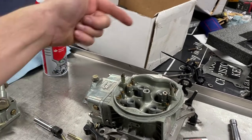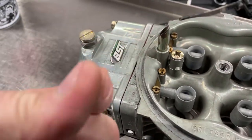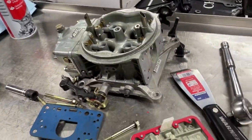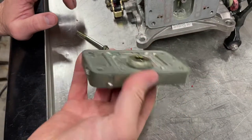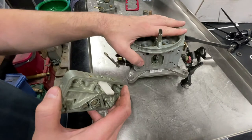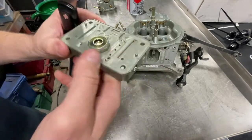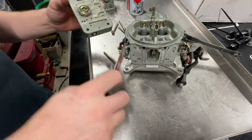If you have a top nut that's not completely sealed, it could be drawing stuff in through that. If you have a blown out air filter, you could have any number of things getting in — even in a box, a carburetor might have a little extra particulate or dust. So let's go through the circuitry. I'm only going to do one side because it's the same on the other side. Here's the metering block and carb base — you can see all the different ports and circuits.